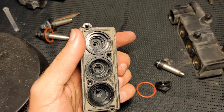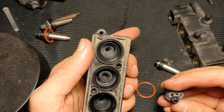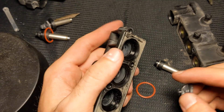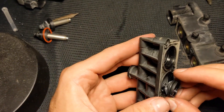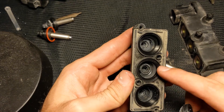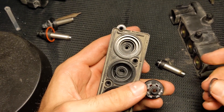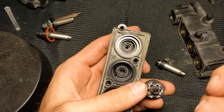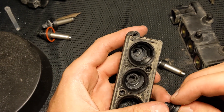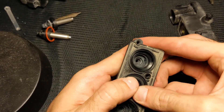This is probably dealing with only high pressures, because this is where the valves share pressure between the two air springs. If one air spring is too pressurized, it'll send air to the other air spring or vice versa — this is the solenoid that performs that task. I can see why it's a little different in its engineering. It's actually a little dry, but it's fairly similar overall and you can put it all back together just like the other one.